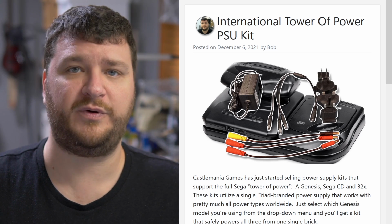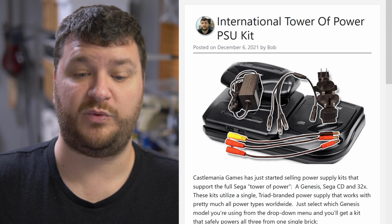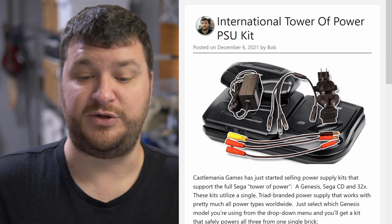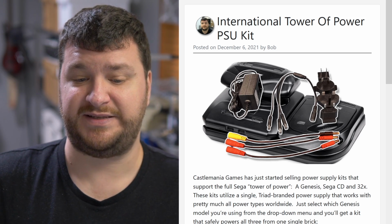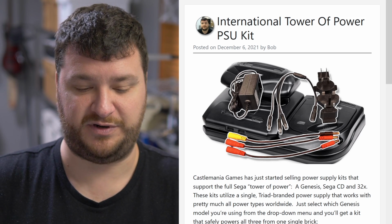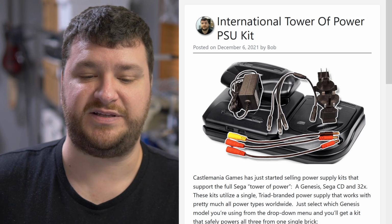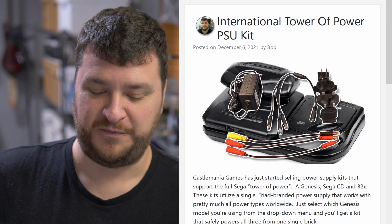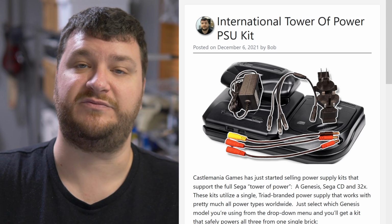Now, there's some more technical info. If you're not interested in that, skip to the next section, but I did want to talk about a few things. First, I normally would never recommend connecting one power supply like this to multiple consoles, but I do think it's perfectly fine and could even be a step up for this scenario. And the reason is, even if you unplug all of the power, you're still combining all of these consoles with their internal connectors, and you're already sharing ground a million different ways here. So you're not going to run into the scenario that any musician who ever had a pedal board would run into, in that sometimes if you have one of those power distributors and you're sharing grounds, you get an audio hum, or in the case of consoles, you might get some video interference.